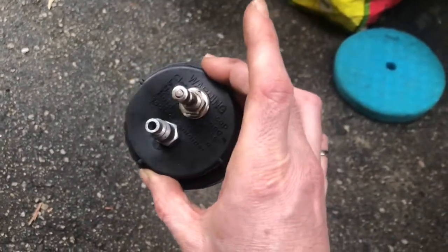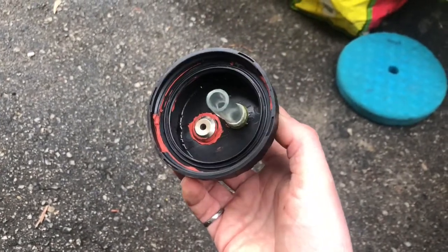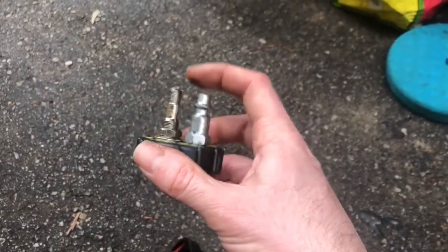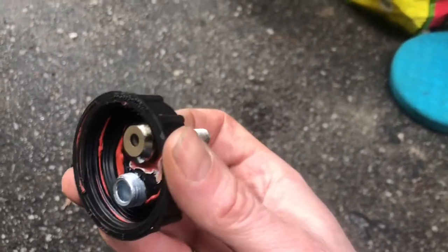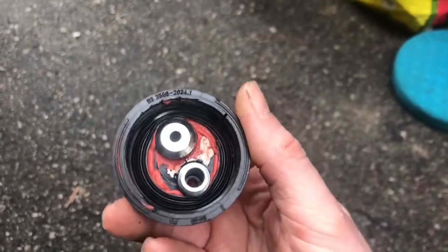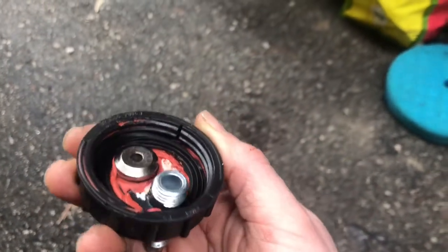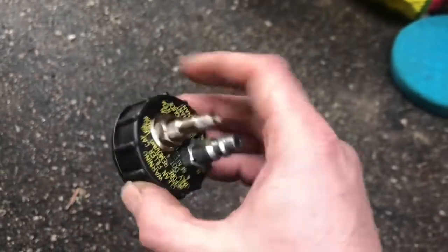This one is for the P2 style Volvo — all of the S60s, V70s, and S80s use that. Then I've got my second one here for my 2010 Volvo V70. You just need the adapter — drill through and poke it through. You'll see that I had to put some of that sealant product in and around the gasket to seal that properly, and you get an airtight seal.